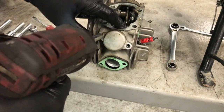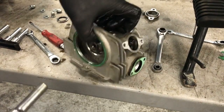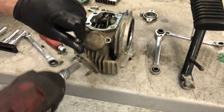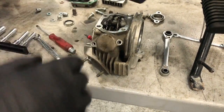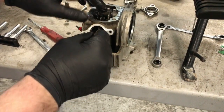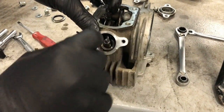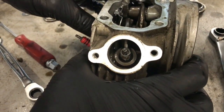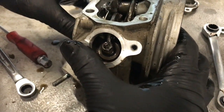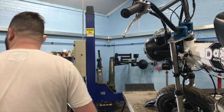One off, two off. Right. So, valves. We might have to mess about with the tappets a bit on this, because the cam will have a little bit more lift, so these will need a little bit of an adjust and a feeler gauge underneath them. Good old fashioned adjustable. Right, so who needs hydraulic?